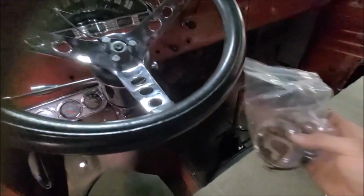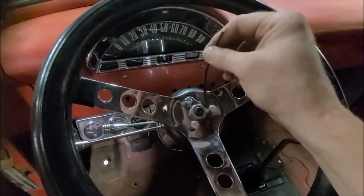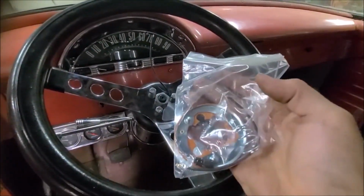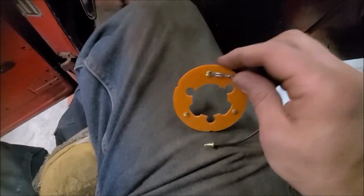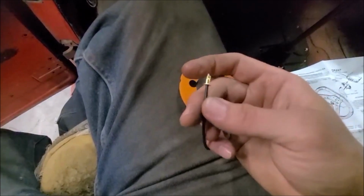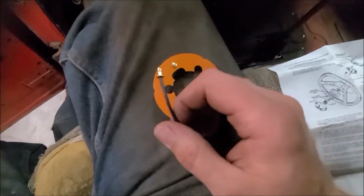But so now I'll work on getting the horn button thing connected. I did have to cut the connector off this guy. It had a spade connector on it, but that wouldn't fit through the steering wheel, so we'll just have to re-terminate a connector on there, which is not a big deal. I'm not completely sure how this connects anyway. It looks like it might have a smaller type spade connector in there, so I'll get in there and check that out now. Okay, so the little spade connector that's on the wire in the kit plugs into the back of this part. This thing's weird though. I guess that's a rivet or something. I'm not familiar with that connector, but that's obviously got to connect to this. I'll just cut that off and put my own connector on it, but I don't know what they were going for with that unless I'm missing something.